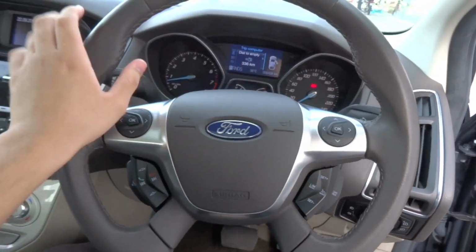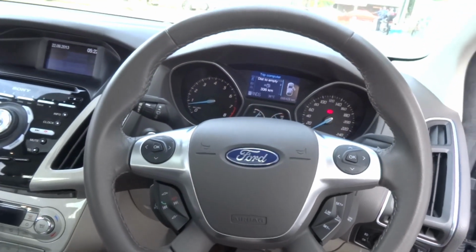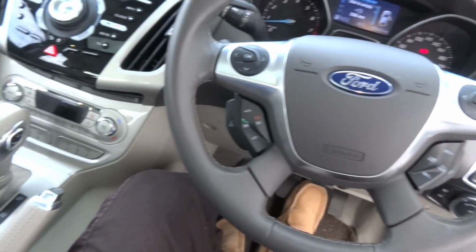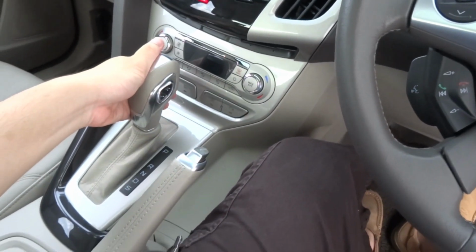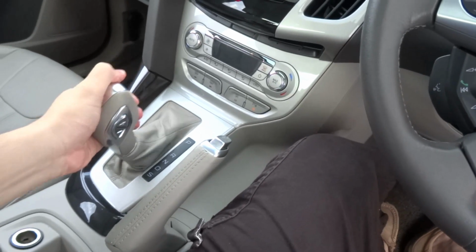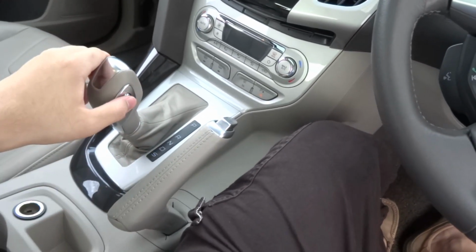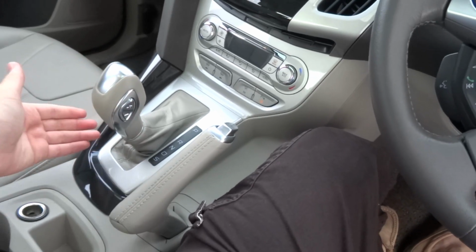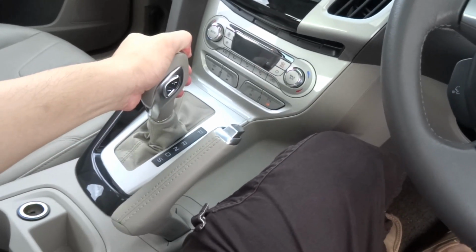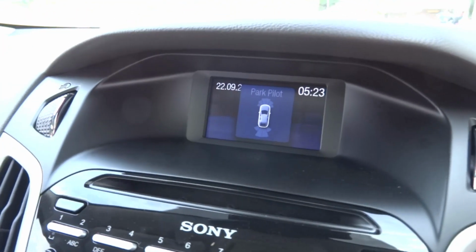This transmission uses a dry clutch setup, and it does have 2 sets of clutches, one controlling gears 1, 3 and 5, while the other controlling gears 2, 4 and 6. Power shift eliminates the need for a clutch pedal found in a conventional manual transmission and a torque converter found in a conventional automatic transmission. Power shift also gives drivers better fuel consumption, smoother shifts, and less lag between shift times.